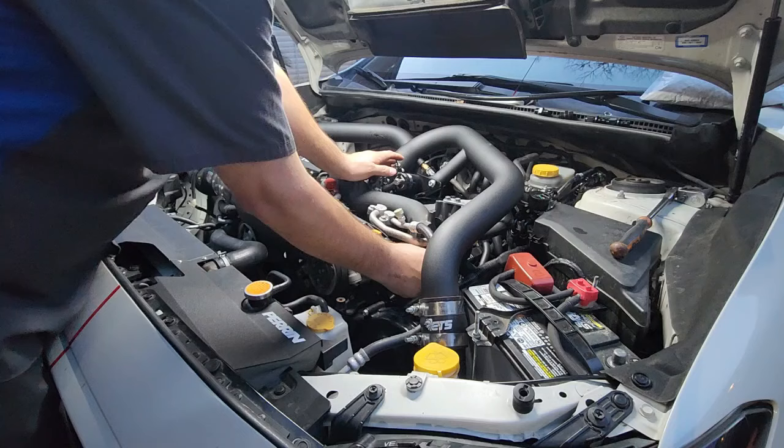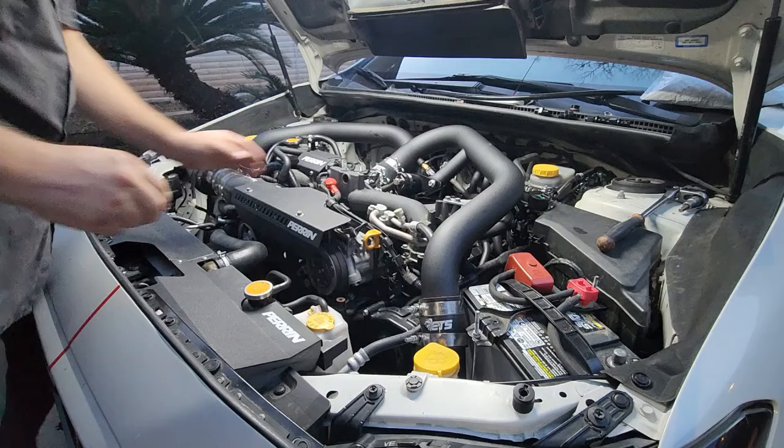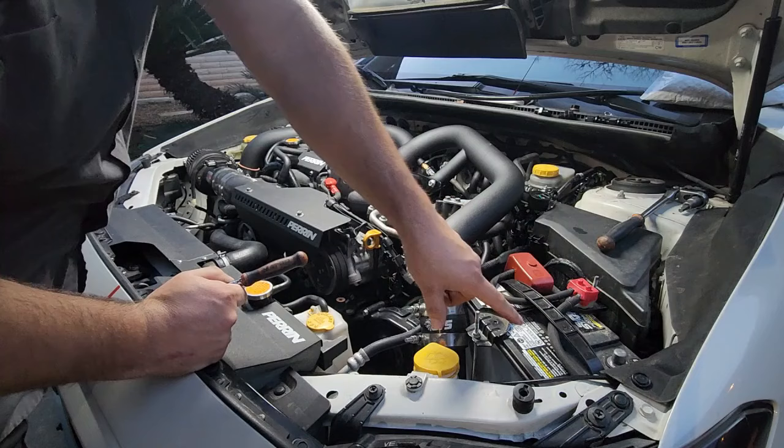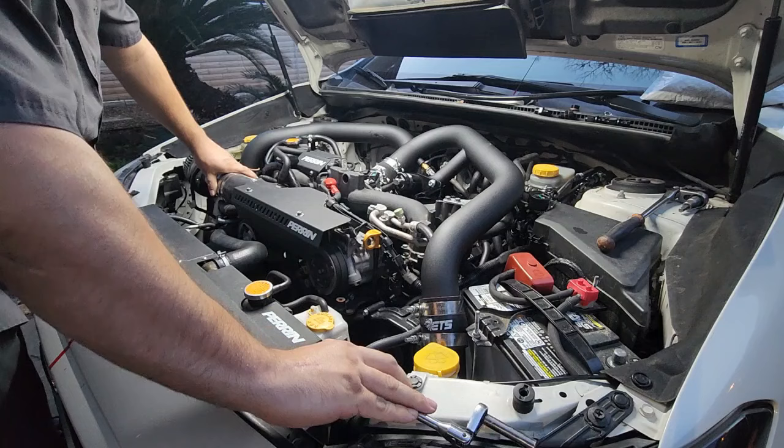The rails are not at the same level at the front of the engine — on the driver's side they sit back further, passenger side they sit up a lot closer to the front of the car. I'm going to pull the intake off to make it a lot easier to get that other one. Also, don't forget when working on the fuel system to unplug your battery. Don't chance it — it's a lot of money, not to mention your life.